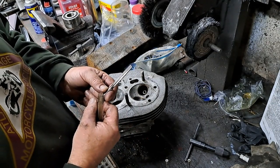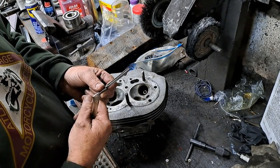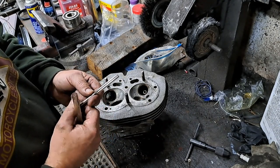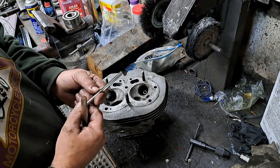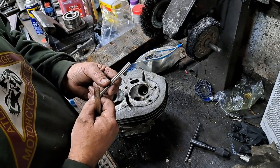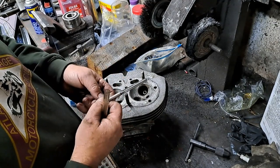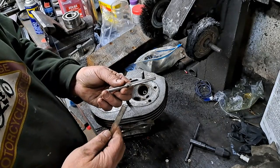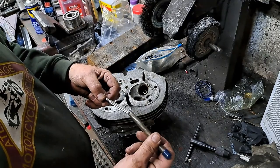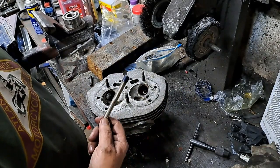Frankly, I do know how to sharpen these up, and I will probably sharpen this up before I put it away this time, but in any case, most people don't know how to do that, and if you've never worked around a tool and die shop or anything like that, then don't try sharpening it because you'll only mess it up. And anyway, when they start to get dull, the best thing to do is just replace them. Like if you took that somewhere to have it sharpened, it would cost you more than it would to just buy a new reamer. So anyway, buy top quality stuff when you can. Anything's better than nothing, though, having said that.